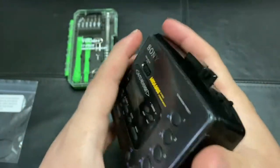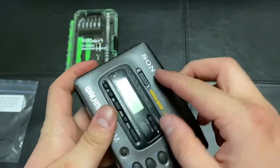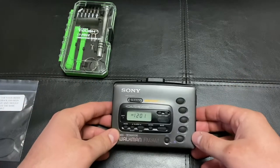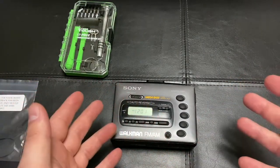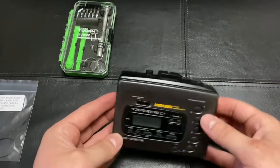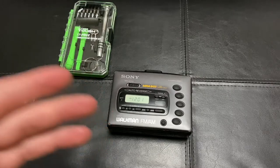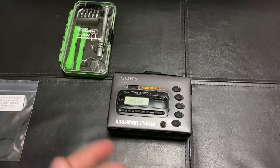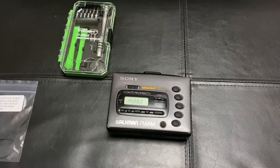You can see — it's fixed! One thing you can still do is clean the capstans, or whatever they're called, the rollers and the tape head — just very gently apply some rubbing alcohol. But really it comes down to that belt. If you can get to it easily, look at it, and if that's what it needs, get one. I'll update when I put a cassette in, but it sounded good before and that was a 20-year-old belt, so a brand new one should last a long time. If you ever want to use it, it'll be ready to go. Let me know if this helps — thanks for watching and I'll see you in the next one!